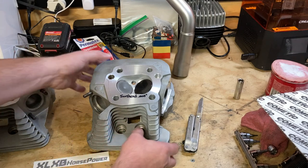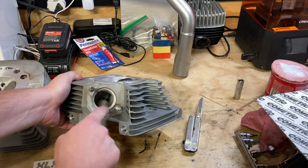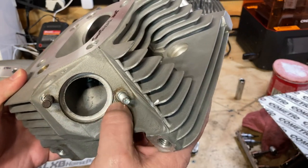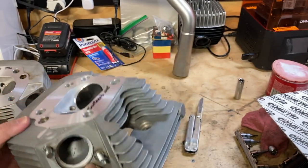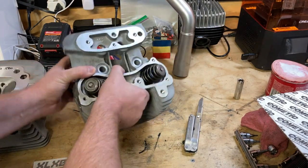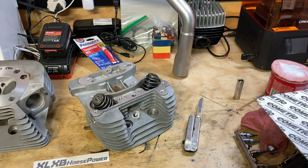The other thing he had to do was put an insert here in the exhaust. This is the front cylinder head, the exhaust valve. That had a helicoil installed by yours truly. It did not go so hot, it actually went in crooked. I said, heck with it, because I was doing it while the heads were on the bike. It sealed and lasted for 2 years, but it bothered me, so I wanted it fixed properly. And Chad, again, came to the rescue.